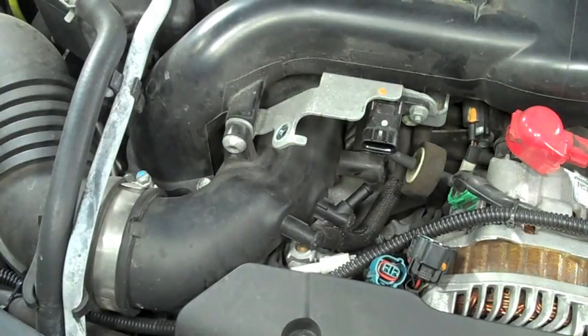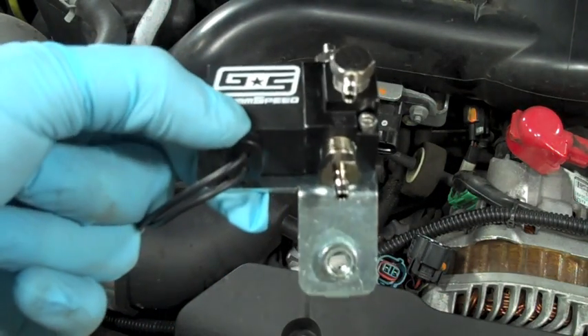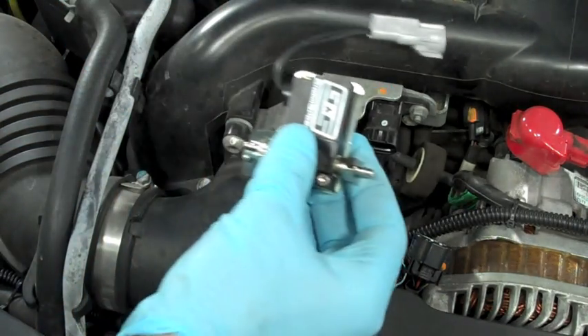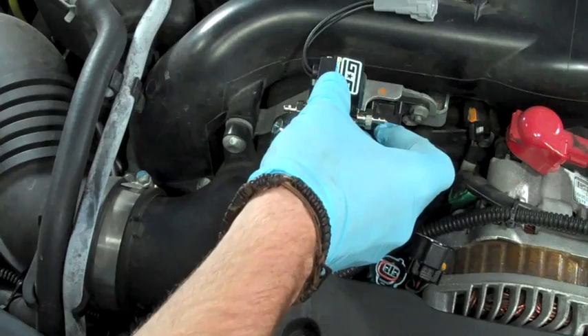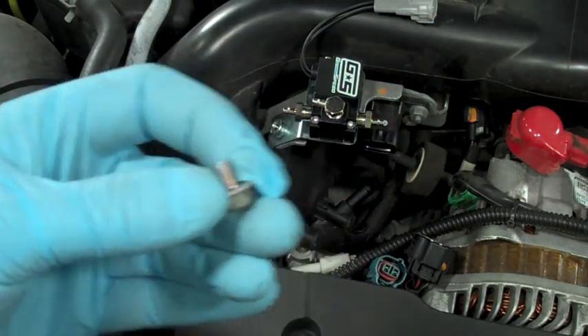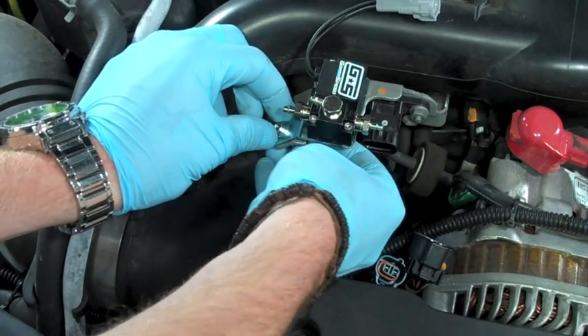The first fitment we're going to show you is for the 08 WRX. This bracket is a silver bracket that mounts on top of your OEM BCS bracket. It's going to fit over like that so the GrimSpeed solenoid actually sits right on top. The bolt we're going to use is put in upside down and screwed back through, as the nut is now on top.